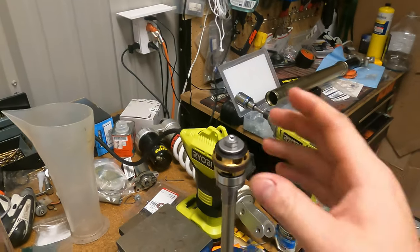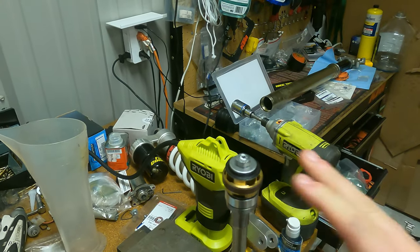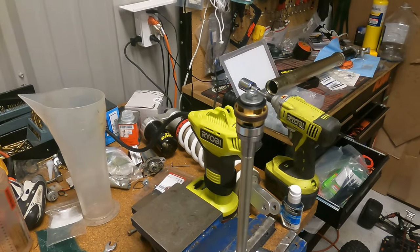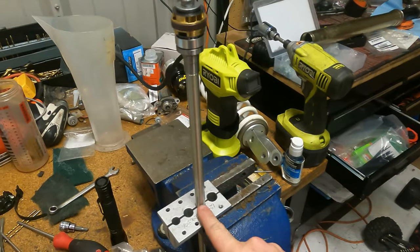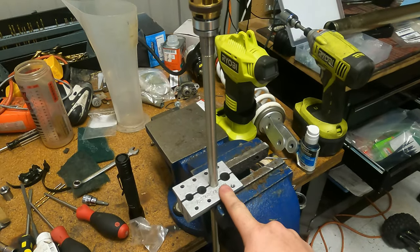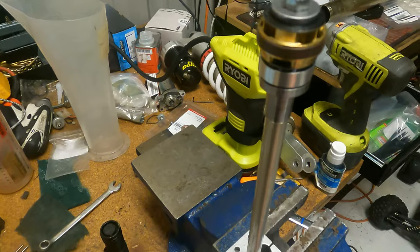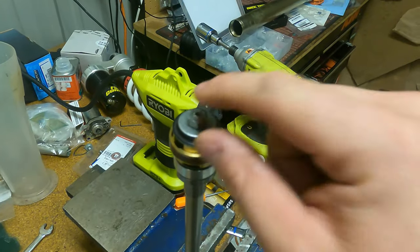As far as advice for beginners when you're doing your first rebound or mid valve assembly, the most important thing is make sure you have the right tools. Do not scratch this shaft or you've pretty much ruined it. Get the shaft out, have something good to hold it with so you can work on it — peen off the top and get the nut off.